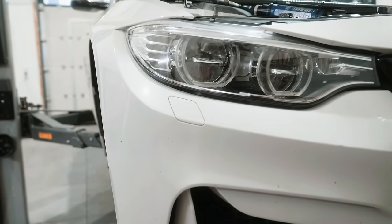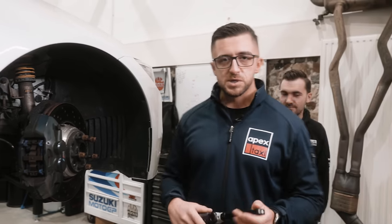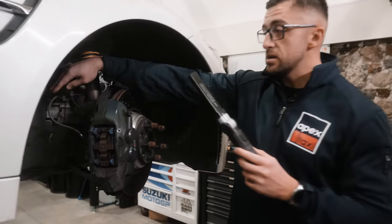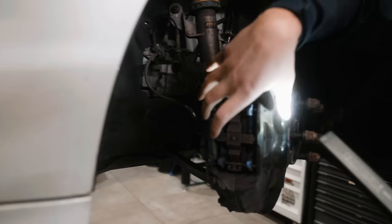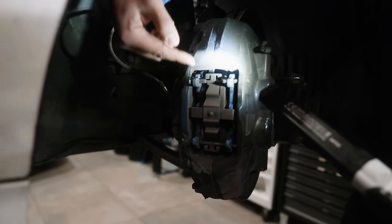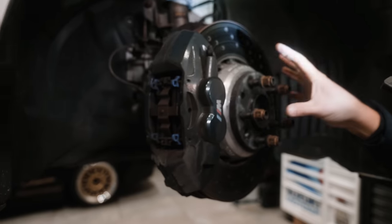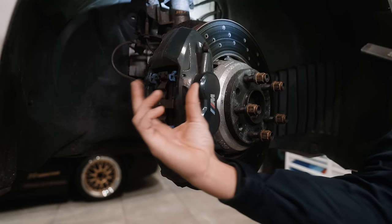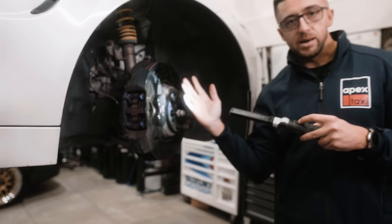Let's raise the car up. The fluid goes through your ABS system and then it ends up here in your braking line. The fluid is sent towards the brake caliper, and inside you have brake pistons. The pistons press the brake pad against the brake disc, which is mounted on your wheel hub. At the same time your wheel is also mounted there, and it is stopped by the brake caliper and brake pads squeezing the brake disc. That's essentially how your car comes to a stop — a simple visual explanation.